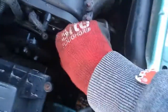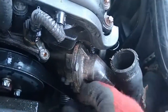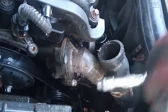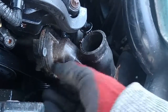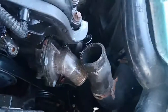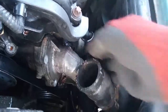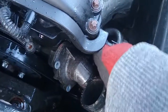In this case the engine won't be running at its optimal operating temperature, and you might lose some efficiency, but otherwise it's not especially dangerous for the engine. If the thermostat gets stuck closed, then you're not going to get any coolant flow to the radiator, which is much worse for your engine and could cause it to overheat, leading to loss of coolant, head gasket failure, and possibly a warped block or head. Symptoms of a thermostat stuck closed could include seeing a high temperature reading during normal driving, or if you're losing coolant or having other overheating issues.